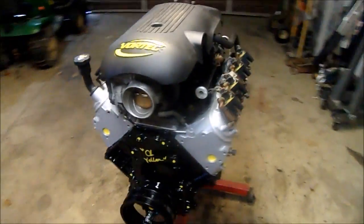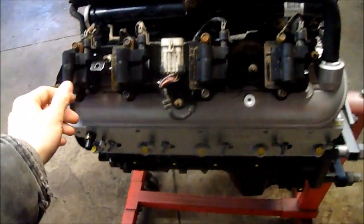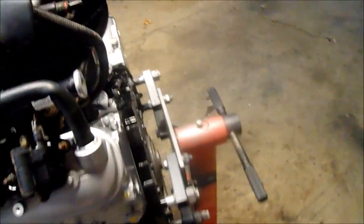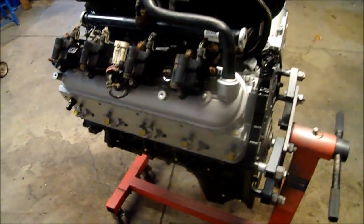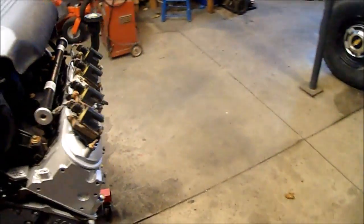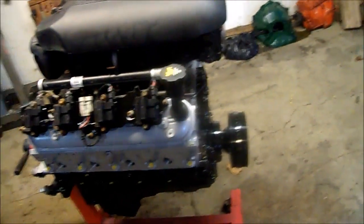So I'm really happy with how it turned out. I got some NGK TR55 plugs on the way. Those are supposed to be good plugs to run in this, and then I got some performance spark plugs. I like to get good spark plugs. I got those on the way because I just painted over these old plugs. I always get new spark plugs. I don't care if the previous owner said they were recently changed. I just like to always put fresh plugs in stuff. It makes a huge difference sometimes when they're gapped right and you got some nice plugs in there.